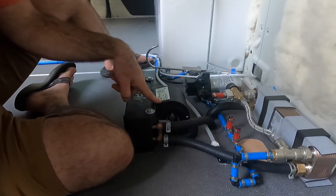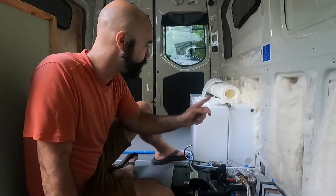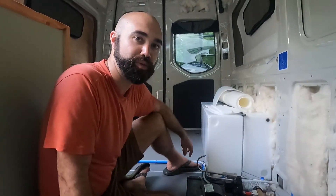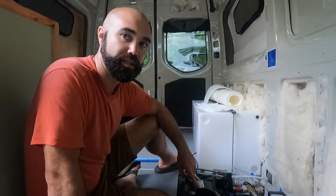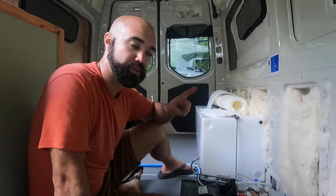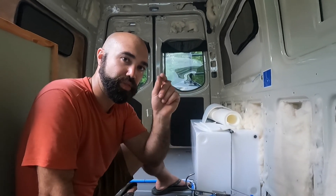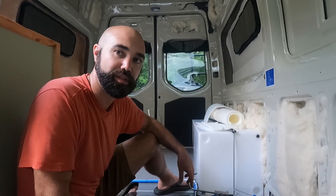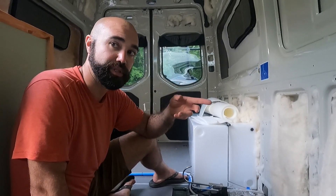You can tell how much I'm sweating. This air heater has a variable speed motor control with five fan speed settings. There's also an auto mode with a temperature control knob — you can set it to auto and control the temperature, although the knob doesn't have numbers, it's just a thin red line or a fat red line depending on how warm you want to be. When it's really cold the fan goes on high automatically, and as it gets closer to the set temperature the fan slows down.